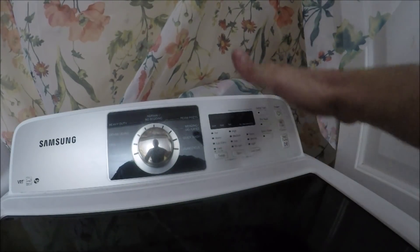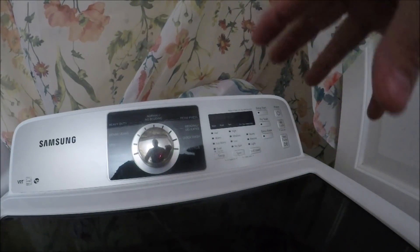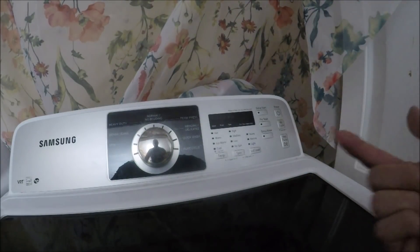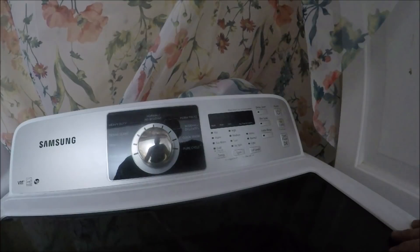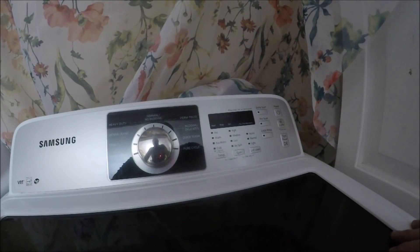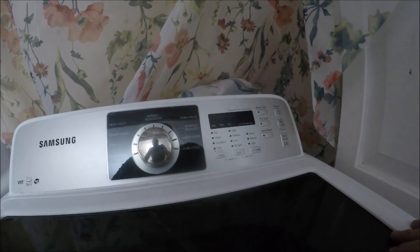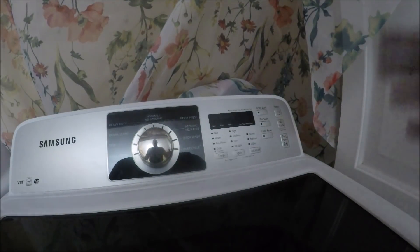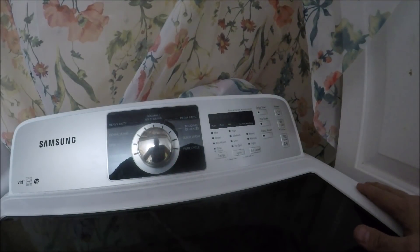This is already turned off from the cycle I did, and the fix worked perfectly. It went straight through its cycle with towels in there that usually cause the drum error. It rinsed them properly, it spun them properly, and it worked perfectly. The tubing fix on the springs works great. I do wish I had gotten inch-and-a-quarter inside diameter tubing instead of one inch, but that one still works fine. I may go back in and put another zip tie on it, but either way it works.